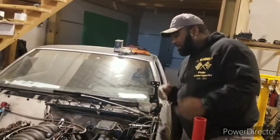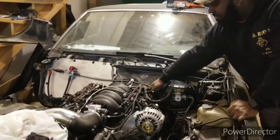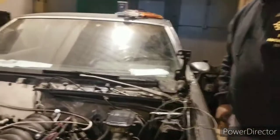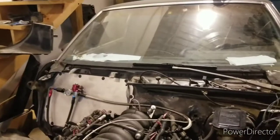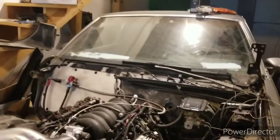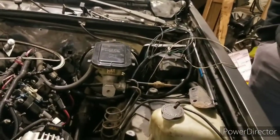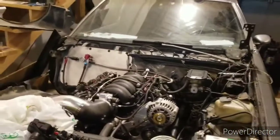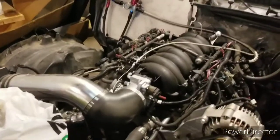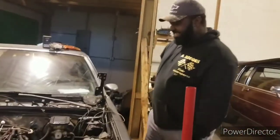We're going to go up in injector size. We're going to do the turbo. I've got to figure out the PCV system — I don't even have it set up yet. With a turbo, you're going to want to vent — it's going to have some blow-by. You're going to want to either put that in a catch can or vent to atmosphere. Right now one side is vent to atmosphere and the other is going back into the intake. Under boost, boost is going to push that. You might plug that off and come off of it to a catch can or atmosphere. Catch cans look cool, and you can probably make one out of something — just remember to check it, because some people forget and it gets full of oil.